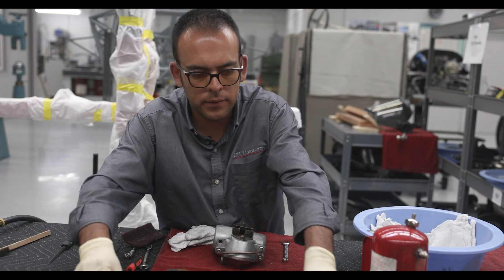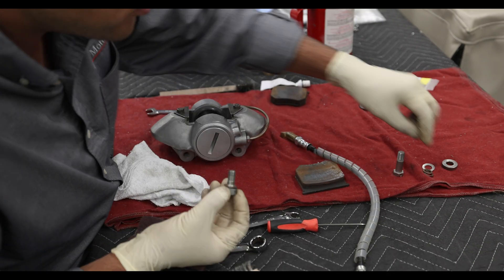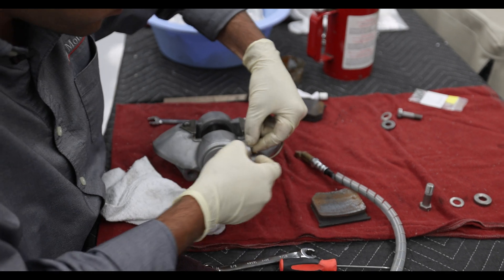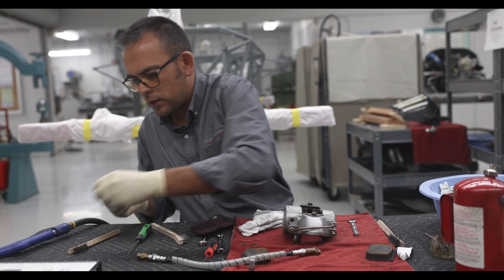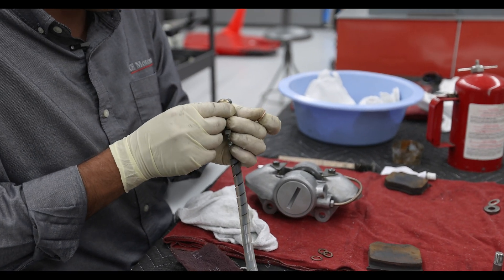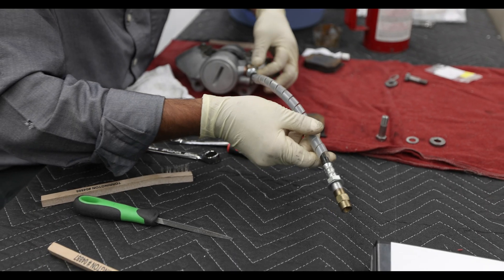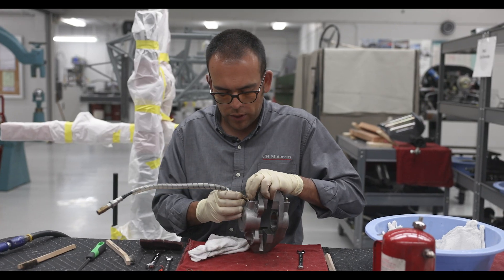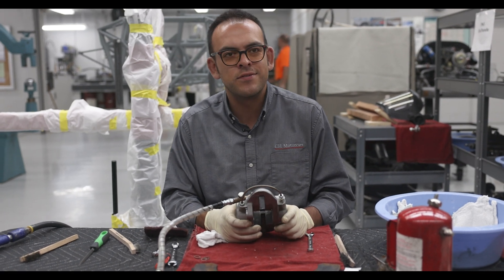Where our brake hose goes, we had a banjo bolt with one washer on the outside and two on the bottom — the reason for two is that the base is a little recessed. So I'll install the washer on the outside and the two washers for the shoulder. I'm not going to snug this down completely; I'll wait until it's mounted on the car so I know the direction it should face. And that is how you rebuild the brake caliper. We'll see you soon for another video — thank you.